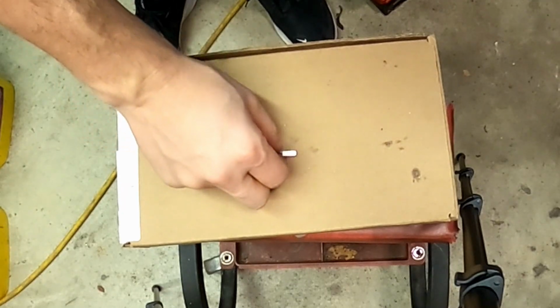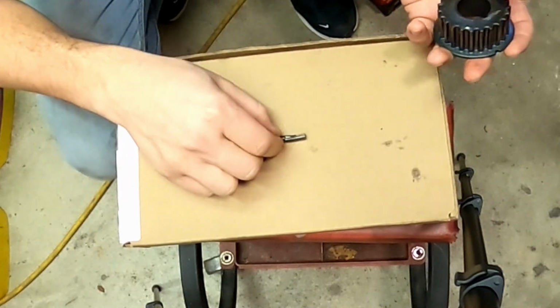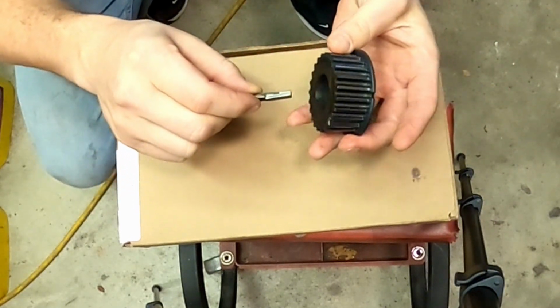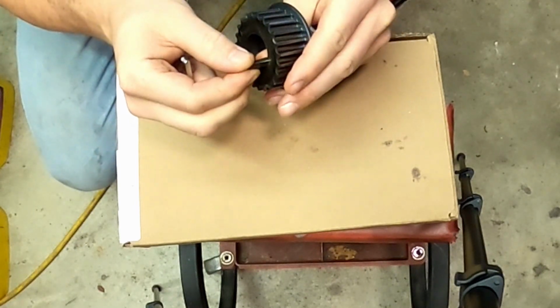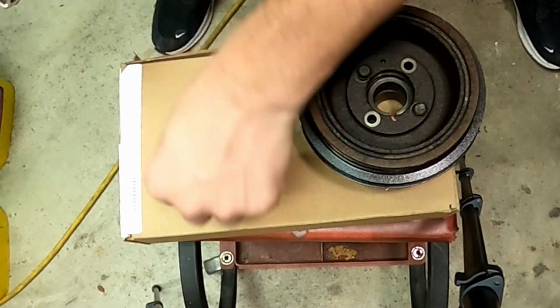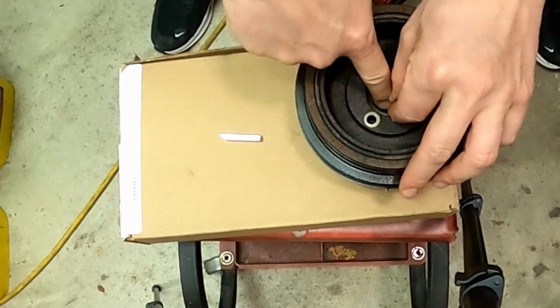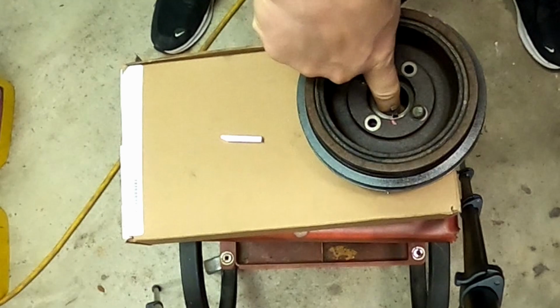Let's talk about what went wrong with our existing pin. You can see how bent this is because it got stuck. You can see the little bit that hangs out. That would normally feed into the crank boss here like this. So this whole assembly is still going to go in there. And then instead of this keyway just hanging out in excess after everything's assembled, something like that.